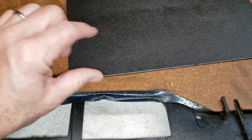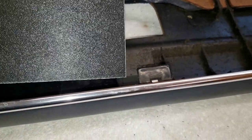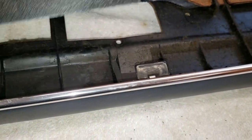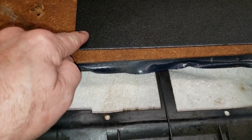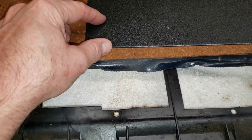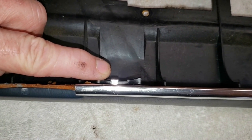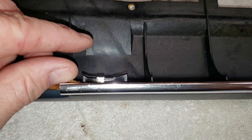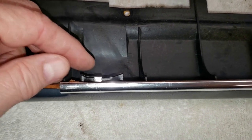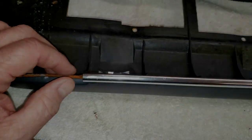I'll probably cut a section and double it up, gluing the pieces together with ABS cement to test the thickness. This piece I'm holding is slightly thinner than the original, so if I make them a little wider they won't break. We'll cut two pieces sandwiched together to make one-eighth inch thick, use the Dremel to cut a clean straight surface, and attach the new flange with ABS cement. Afterwards we'll make new metal shims to reinforce it and JB weld everything together — it should be really, really strong when we're done.